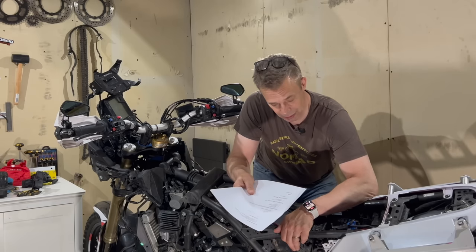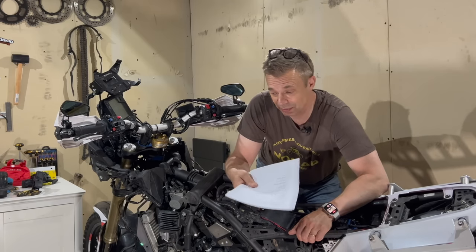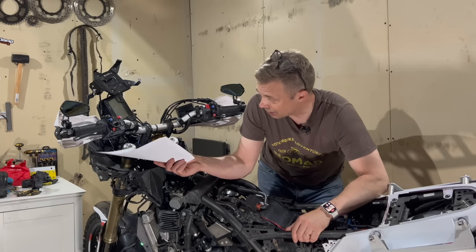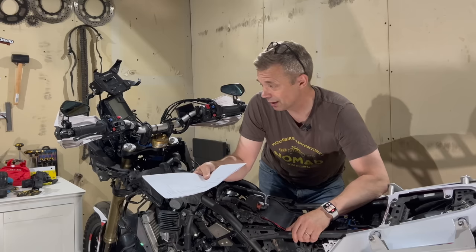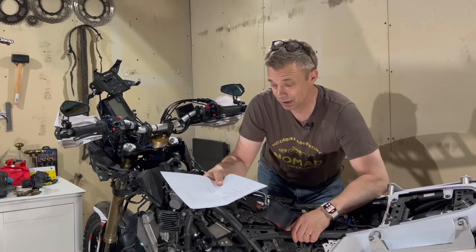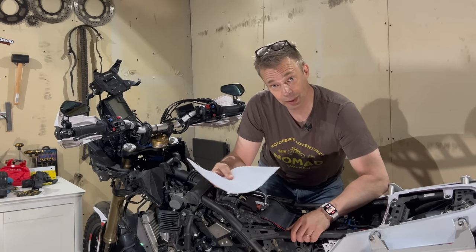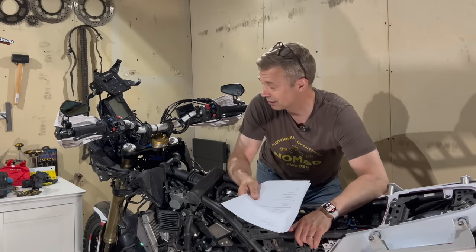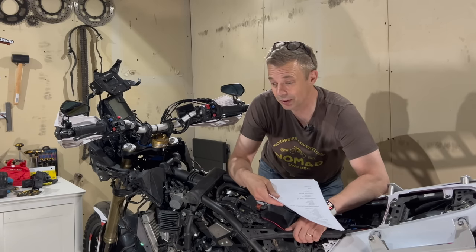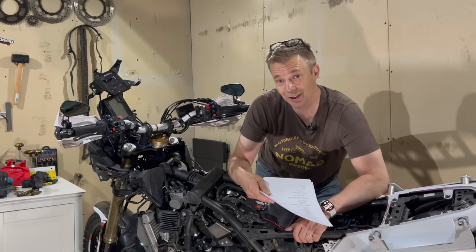So real quick about the suspension, what I've done is I upgraded the rear spring to 85 newton per millimeter for a rider weight of 85 kilos, somewhere there. That's what Rally Raid recommended when I gave them my numbers. I added 5 millimeter spacers as preload in the fork. A better option would be to get springs for my weight on the forks also, but I got them for free, so I just did that. I also set up the rebound and compression to my liking, as shown in my previous video. So regarding suspension, I now like the suspension on this bike for what I'm doing, and I'm not going extreme enduro. I want to go on trips and up in the high mountains on bad roads and stuff like that, but I'm not doing wheelie stunts.